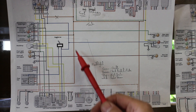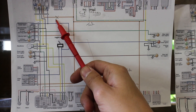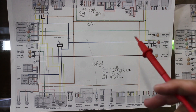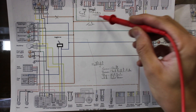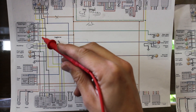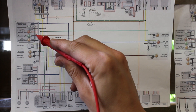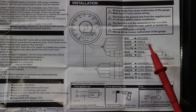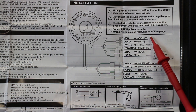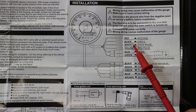We have made that brown wire which gives positive permanent current when the ignition key is turned on. We won't be going to a tachometer - this is one of those nonsense relays you can ditch. We can get a perfect signal from the orange cable of our rear coil. Our digital speedometer will pick up the RPM signal without any flaw. The brown wire also feeds our speedometer with 12 volts. Our neutral wire by the way is not on our diagram - that will go like this. Here we see where our brown wire needs to go.